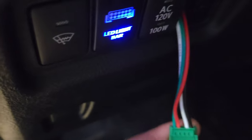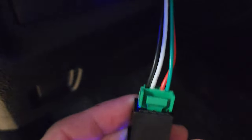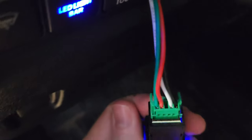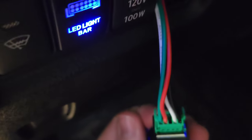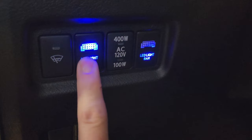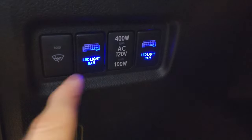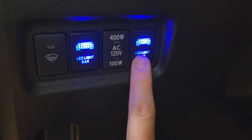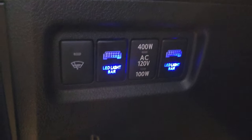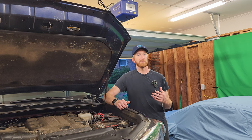With them removed from the dash, the wiring on the switches looks a little complicated. I ordered them from Amazon — I'll put a link in the description. You have a power input to the switch and a power output from the switch when it's pressed. You need to ground the switch, and then there's this extra wire where the backlighting will be on all the time, or you don't have to wire that up at all. I have it lit, so there's a blue glow inside the car — it's very minimal voltage, and I'm not worried about it killing the battery at all. When you press the button on this particular switch, the light will light up on top showing that the circuit is actually powered up.